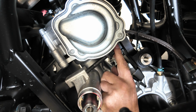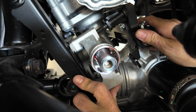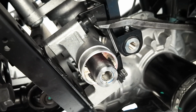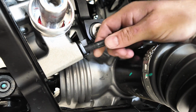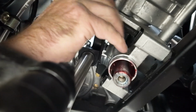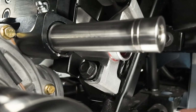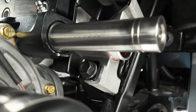So on both Xpedition and Ranger steering rack stabilizer installations, you will have to install the passenger side upper bolt into the mounting bracket before sliding the bracket to the steering rack body. Once the passenger upper is in position in the steering rack and possibly started on the Rangers, the other 3 bolts can be installed by shuffling the stabilizer body bar back and forth. Sometimes it can be a dance, if you will, getting all 4 bolts installed and aligned.